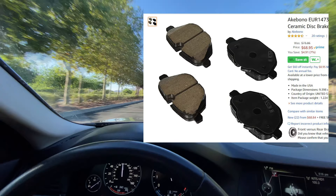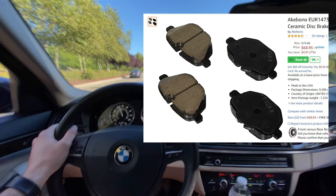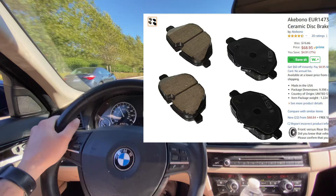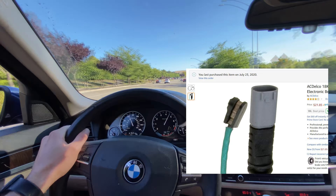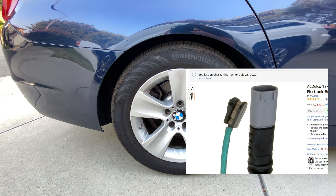Let's take a look at the parts that you're going to need — I'll put a link in the description below. For the rear brake pads we're going to use the Euro 1473. These are OEM equivalent, so they're not the actual OEM but they're just as good — I had no squeal with these brake pads. The second thing you're going to need is one brake pad sensor. The sensor gets eaten up as the brakes wear and that's what gives you the signal on your dash that you need to change your brakes. If the sensor did not go off you could probably reuse it, but sometimes they're brittle when you take them out, so maybe have one ready to go.